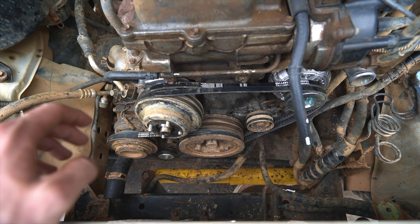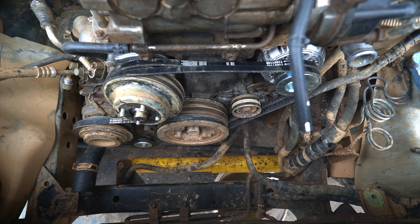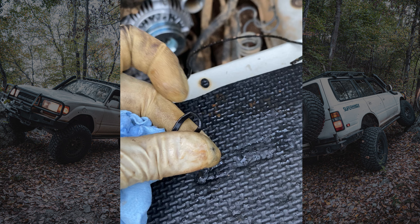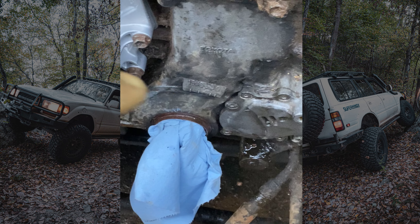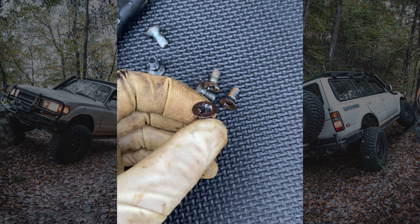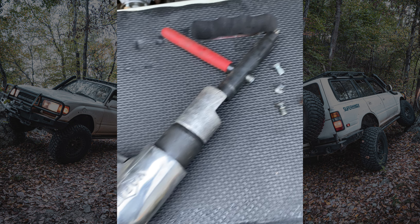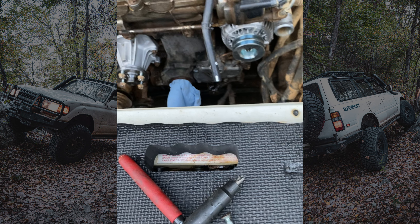This is the old oil pump gasket — as you can see it's pretty brittle, and they end up breaking, cracking, and leaking all over the place. That's why people end up replacing them. You do have to pull the harmonic balancer to get to it. There are Phillips head screws holding the oil pump cover from the factory, and this one was just about stripped. What we used was an air hammer with a Phillips head attachment to rattle them loose.